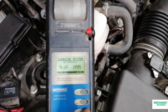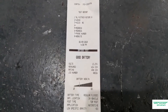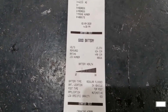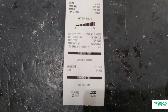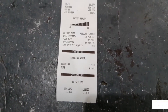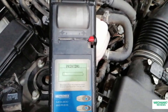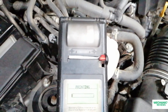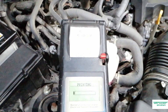At this point we can go ahead and turn everything off including the engine. Now we have got the results. No-load voltage was 13.86 volts. Loaded voltage was 13.81 volts. This particular Lexus vehicle has a complex charging system where they actually monitor current at the battery — that's where you can see some variation in the voltage. But we are at an acceptable level. We look at the crank time against 11.91 volts — that's the average volts — just a little over a second, and there's our battery test result. We have this information captured and in this version you can simply take your results and put them directly to the printer. With the MDX battery tester: results found good, battery cranking system normal, charging system normal as well, no problems identified.